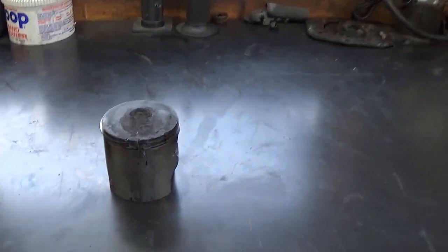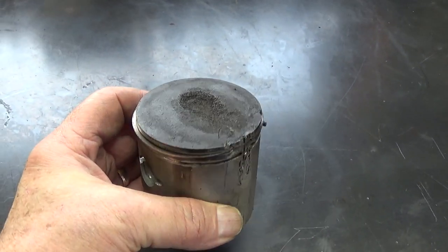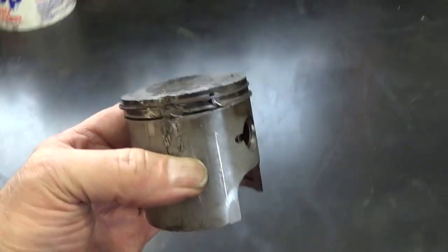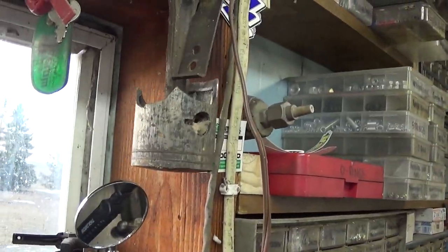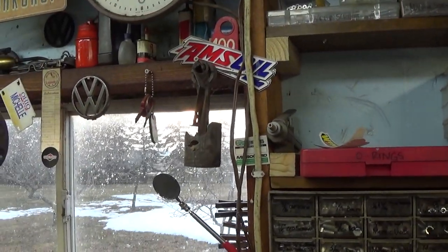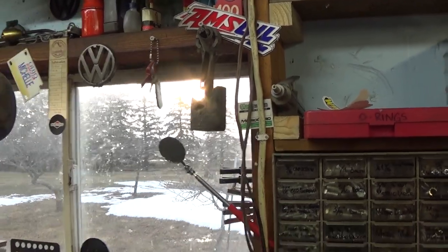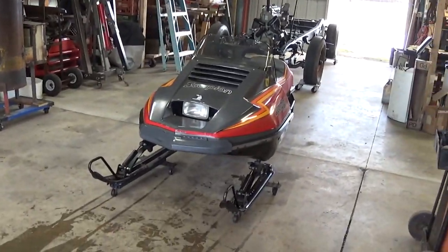That's what I like to see — a clean workbench. Let me show you the carnage again. This was the piston that took the hit. You can see how it almost burned a hole clear through it. She tore up the rings. So she goes up in the rack of shame there. I had one burned down on me — lack of maintenance, leaned out a cylinder and it cooked it. It was a three-cylinder 600 XCR, '97. There it is.